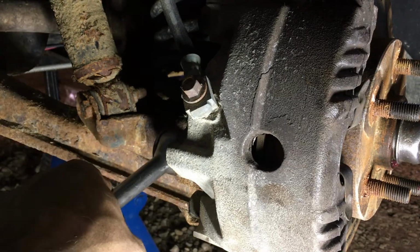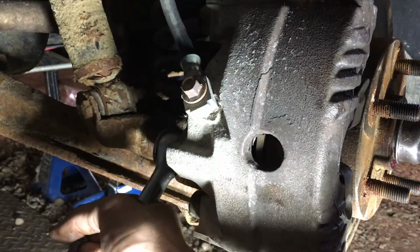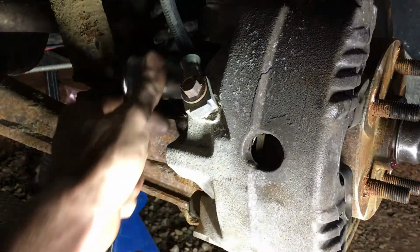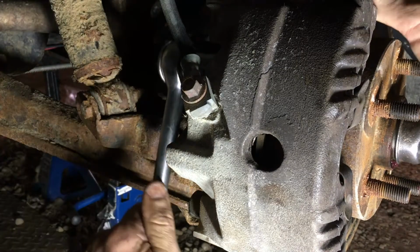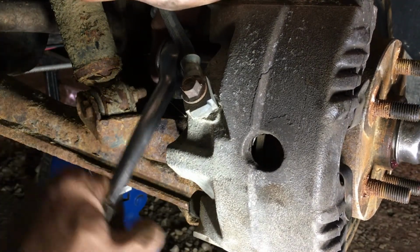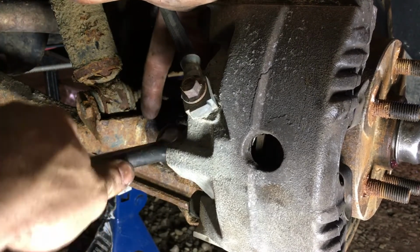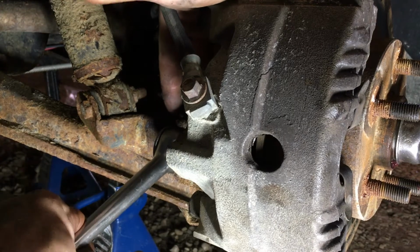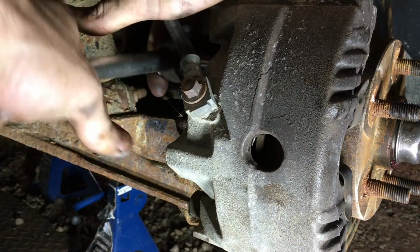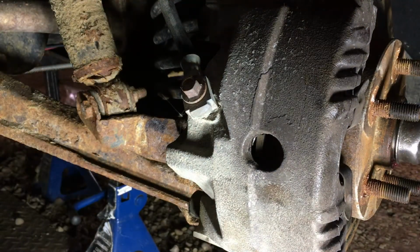Now these, I don't have a torque rating for you, except tight. Like not forever tight, but you don't want to worry about them tight. Not forever tight, but falling off is bad tight. Yeah, exactly. Falling off is bad, but you do want to get them off eventually. So we got anti-seize on them, so that helps, and that makes the bolt slipperier and actually lets it get tighter as well. So we got anti-seize on all that. So that's it.